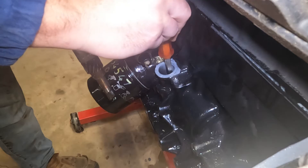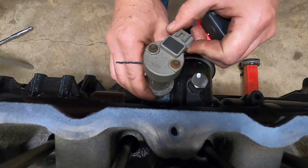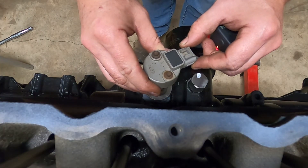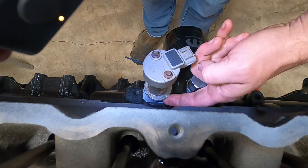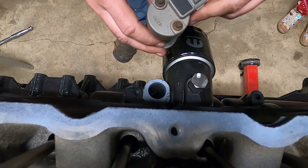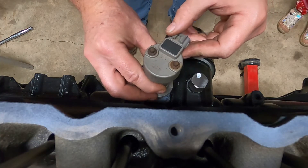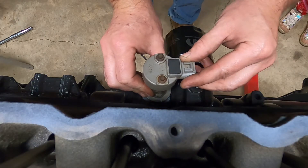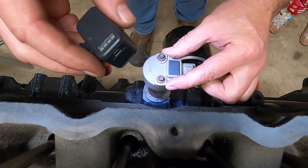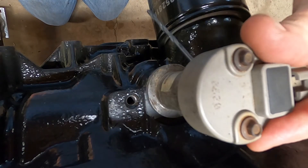After adjusting the oil pump, I'm again positioning the pickup at about the seven o'clock position and sliding it in. As it goes down and engages with the camshaft it rotates. This time it slides all the way down and seats at the bottom — and importantly, it is pointing directly back. We now have the correct orientation: pointing directly back and engaged with the oil pump at the bottom.